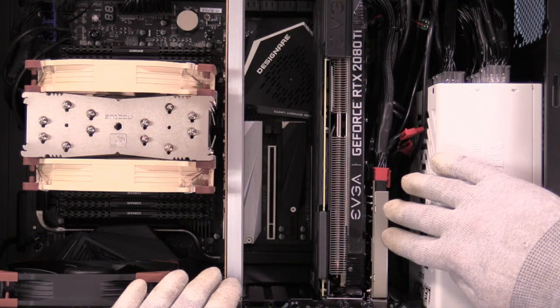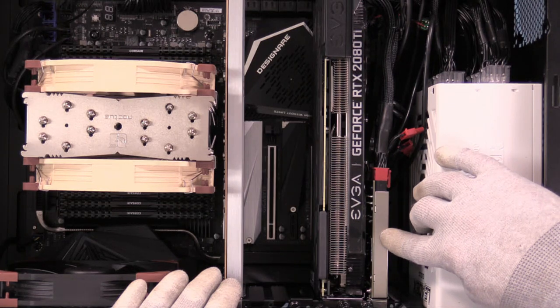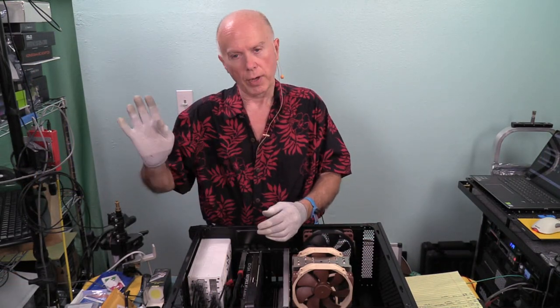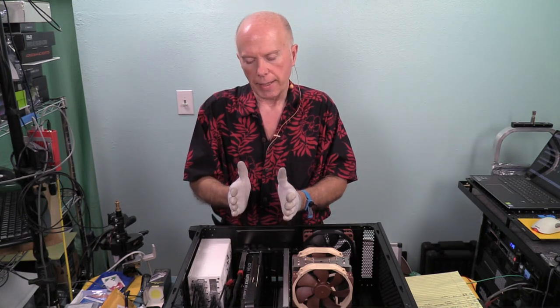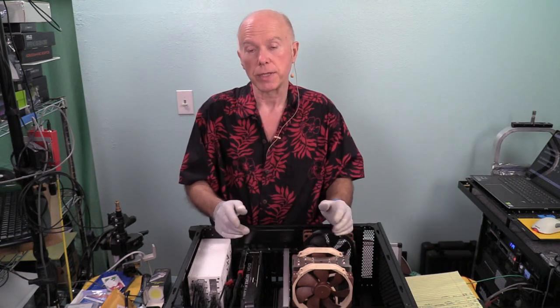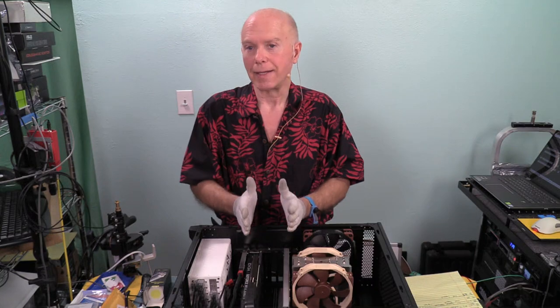And in the second 8-lane slot, which is also the last slot on the motherboard, we're using the Gigabyte Titan Ridge Thunderbolt 3 PCI Express adapter that only uses 4 lanes. And due to resource allocation, those other 4 lanes, we cannot reallocate. We can allocate lanes within a slot, but we cannot on this motherboard reallocate PCI Express lanes to other activities. Some motherboards have that where features are shared, but this is what's called dedicated resources on a high-end desktop.